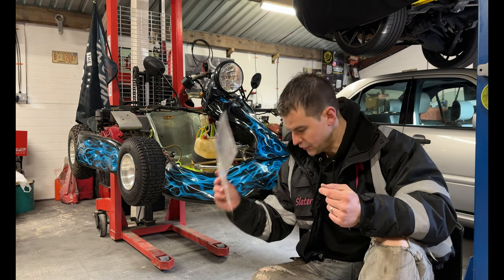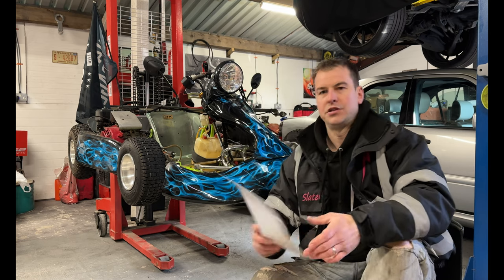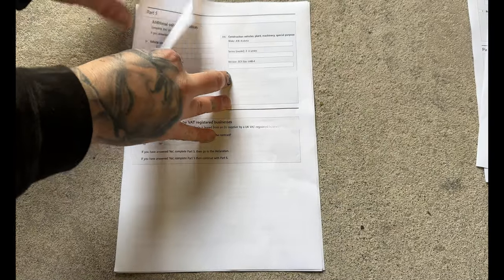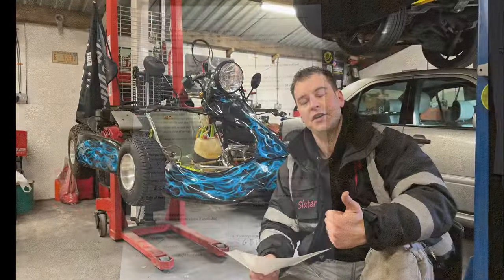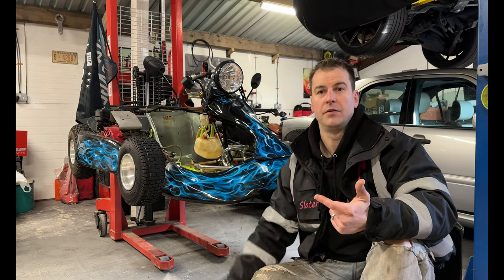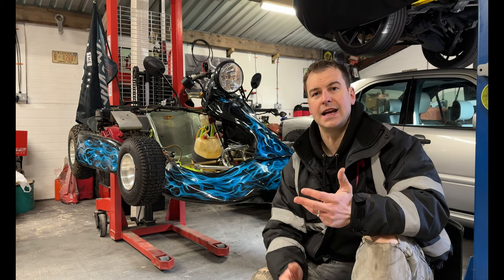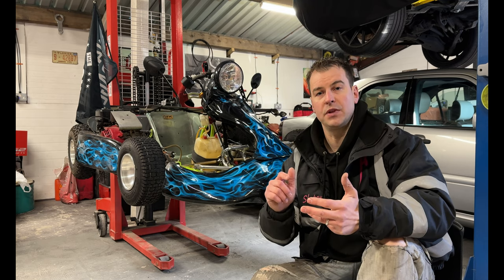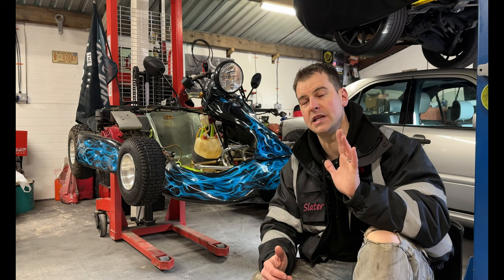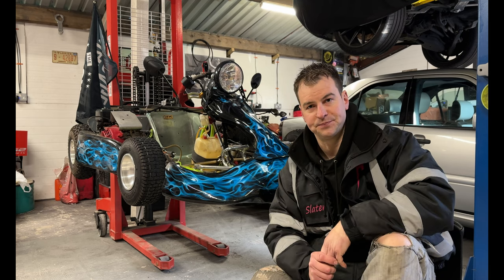Once you've done that, you've got your pass certificate. You're then going to do a Nova form. This is my approval on my Nova form. So what you do is you then get your MOT certificate, you get your manufacturer's letter, you fill out a Nova report. You need your driver's license, and you also need a letter dated within the last 3 months to your address with your name and everything matching on. So that's 5 pieces of paper that you're going to send away. You send these away to HMRC.